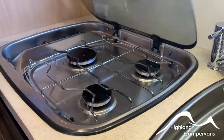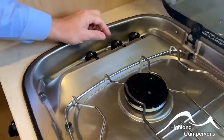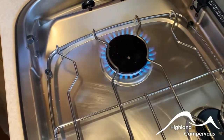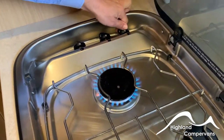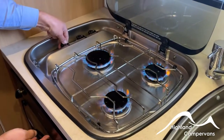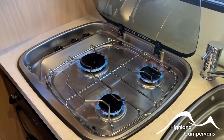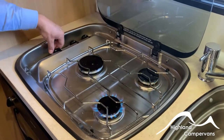To operate the gas hob, lever up out of the way for the glass casing. On the front of the control you have an igniter, and then turn over the main burner first. Press in, hold it in for a couple of seconds, let the thermocouples warm up, and then release. The same process applies for the remaining burners. There are no isolators on the lid, so if it's brought down over a flame it will cause the glass to shatter — make sure the hob is sufficiently cooled before closing the lid.